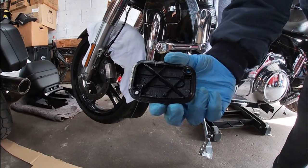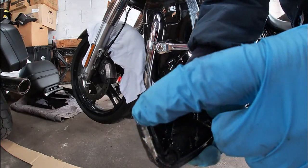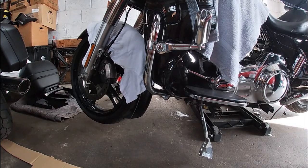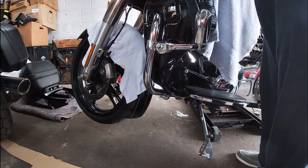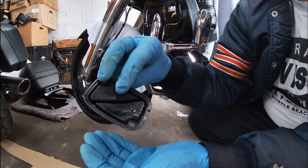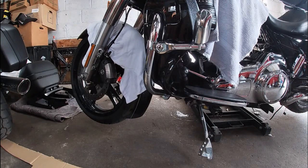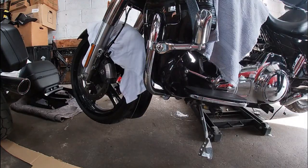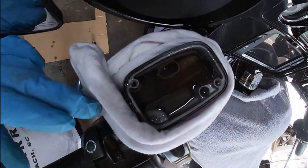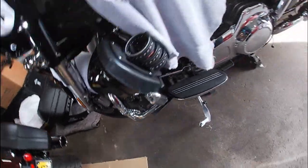Look at the moisture up in there — see that? This bike does not sit in bad weather. Look at the corrosion on the cover. I'm probably going to end up having to get a new cover. I'll clean that as best I can, wire brush it down. And this diaphragm — oh yeah, this is much worse on this side. This is why I bought a new diaphragm for the clutch side, because I did notice some seepage. Look how bad that is in the bottom — I'm going to suck that out and clean out all that corrosion, the black that's in there.